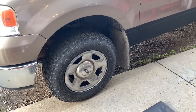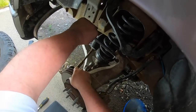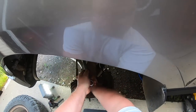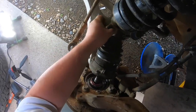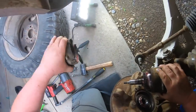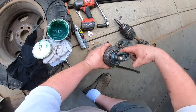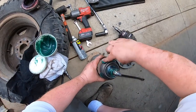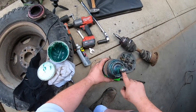Got the old Ford here, and as you can tell, I'm really excited. Once they're on tight, resort to the wrench and mallet trick — as you've just seen. Broke it free. Once you pull that out, be careful of the vacuum hub. Work this thing around and then work it out. There we go. You can throw grease on this now or do it after — I don't think it really matters. Just making sure that it's well lubricated.